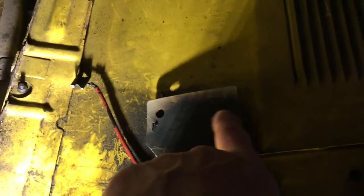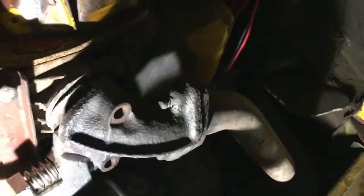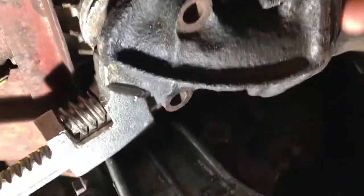The result was that you're getting hot exhaust gases blowing on the back of here and also blowing all around the engine compartment, probably contributing to an overheating problem. So it should have been a 5-minute job to undo a couple of nuts here, here, here and here.